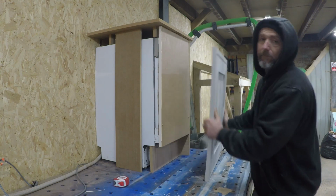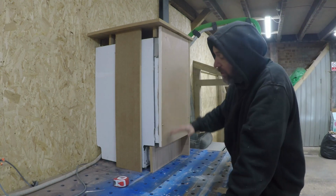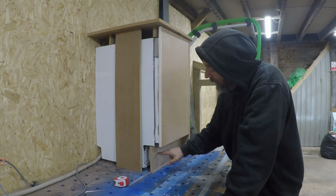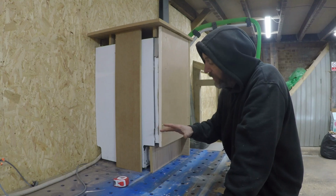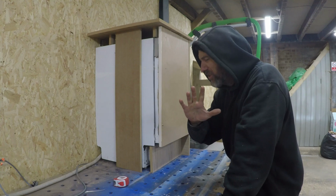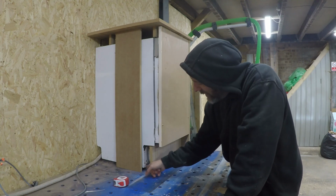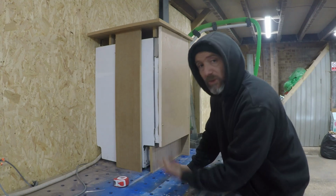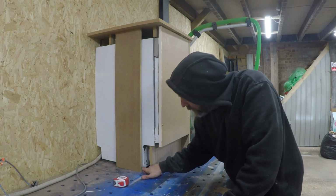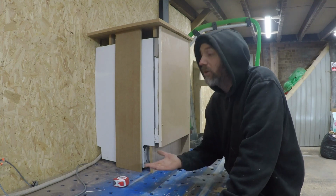And believe it or not, I've gone as low as you can go, and I've never had an instance where that door doesn't clear the cutout when you do it this way round. But whenever you lift the unit up as high as you can go, which to me always seems counterintuitive, because they've even designed it this way. If they wanted you to lift it up to the underneath of the worktop, bear in mind all kitchens are the same size, why would the feet not be longer? You have to literally get it to the maximum of its feet and then put something underneath it.